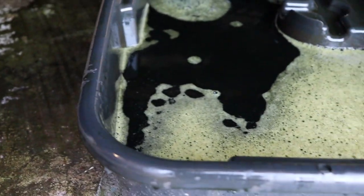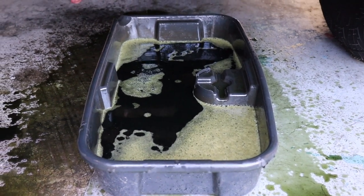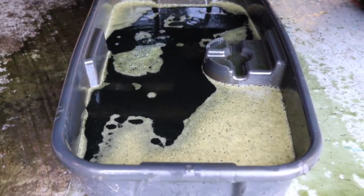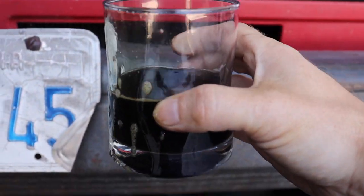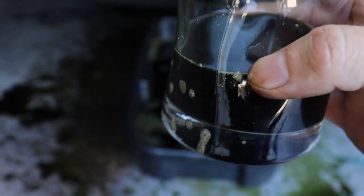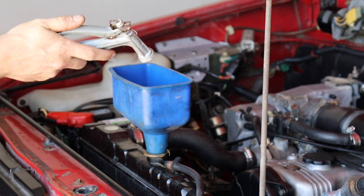How nasty was our cooling system! It's really dark, dark green. We're going to let that continue to drain all the way out, then flush the system with hose water — just do the radiator while we have the hose disconnected. Then we'll seal that hose back up, do a couple heat cycles with just water, and then we'll do our coolant fill. But man, it looks like this stuff did some serious work. Look at that, guys — that's just water and ThermoCure and it's completely blackish with a hint of green.